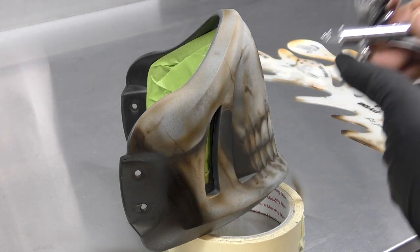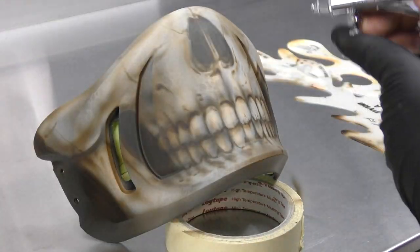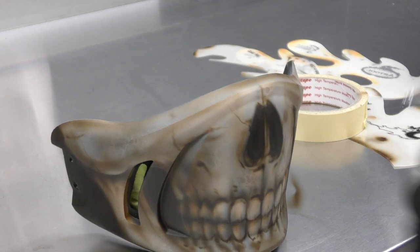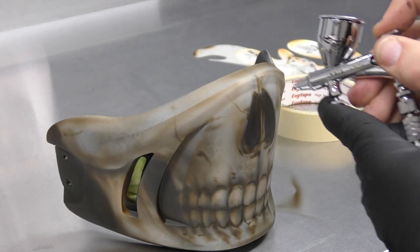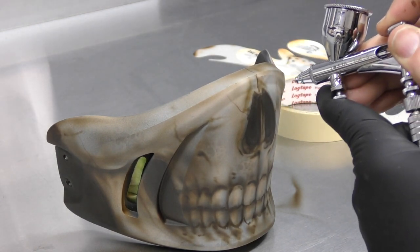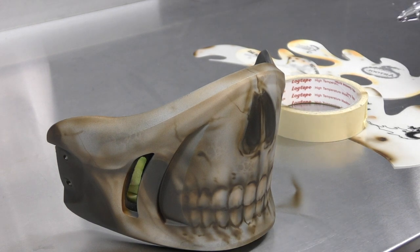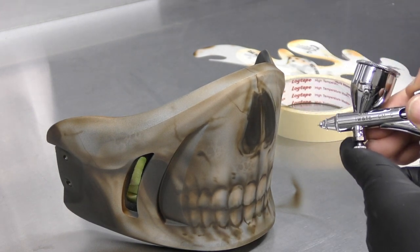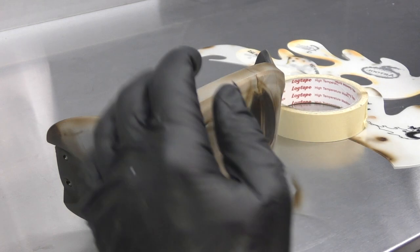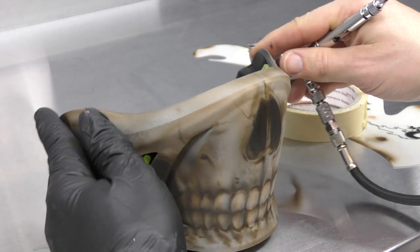keep in mind, if you are going to clear coat something like this, that you should probably speak to your painter and get some FlexAid put into the clear. Let's take that off for a sec. Let's work on this top area. The reason being is by putting FlexAid in, you do the same for snowboards and anything, obviously, that's flexible. Two-pack clear will have a little bit of flex, but not to the extreme where you can see there's a bit of flex in that already.